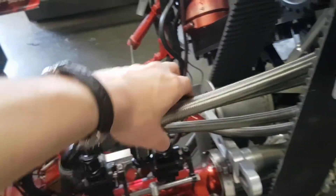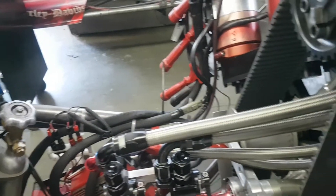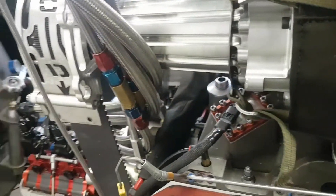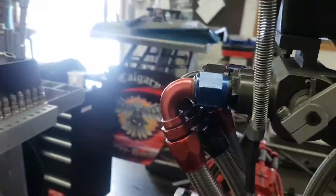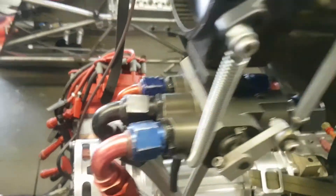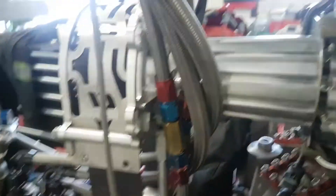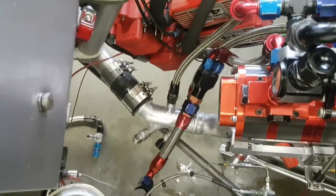Going back — these are the main fuel lines that go from the top of the fuel pump all the way up here. Now we do have them clear the belt. We go up to the front of our barrel valve. So as you can see, we've got our two idle returns going down to — you guys remember what these are — the check valves, back to the fuel returns. It's a simple way of putting it all back to the main line.